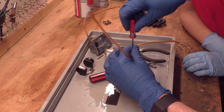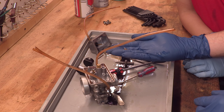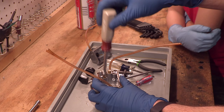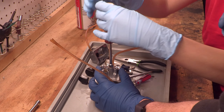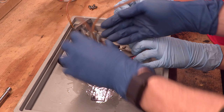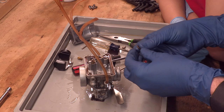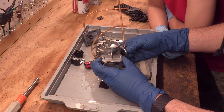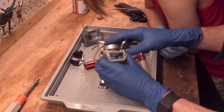We're going to take the pilot jet out as well. So that's your little pilot jet. This one you've got to be really careful with because it's brass — you're going to turn it counterclockwise. I'll hold it and you turn it. Now see, there is a little washer — it looks old. Very interesting, and it also sucks to see that somebody used a star screw there but different screws elsewhere.